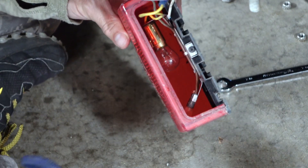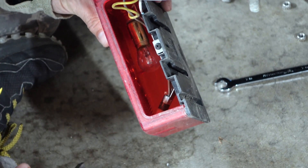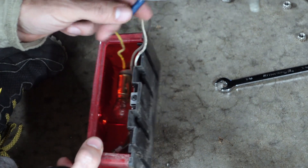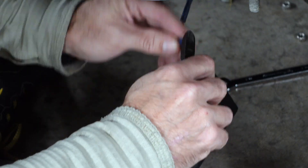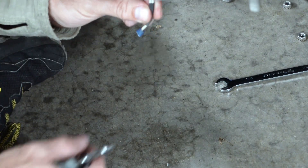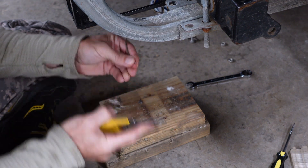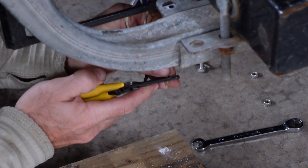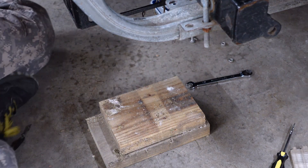This is my left turn signal and I'm going to get in here and try to cut these wires as long as I can possibly cut them. These ones are already spliced together up here and I don't like these splices, so I'm going to cut this a little differently — somebody's already worked on this one. I can cut this brown wire longer, then the white wire. That'll give me just enough space to hopefully splice on my new light. I'm going to strip these wires back — the white one and the yellow wire.